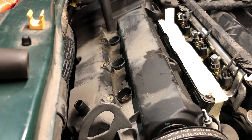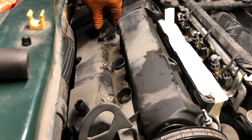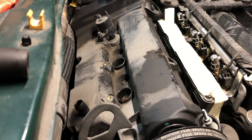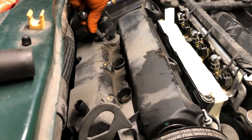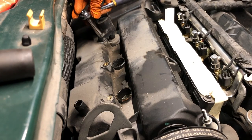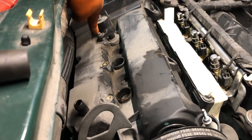Insert the coil back into the hole, then put the bolt on. It should thread in very nicely by hand, especially with the anti-seize applied. Using a small quarter-inch drive ratchet with an 8mm socket, these bolts do not need to be very tight — all they do is keep the coil from moving around and popping off. About that much torque is all you need — just barely snug. If you have a nut driver, a turn of the wrist is all you need.